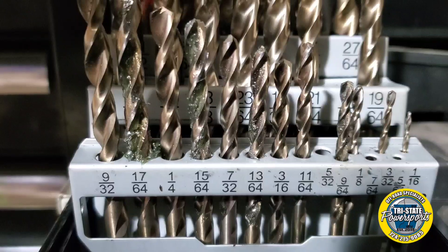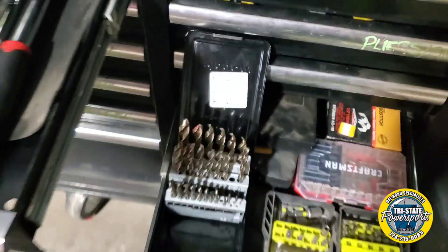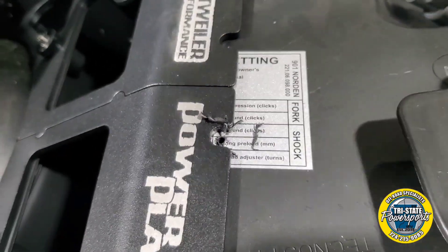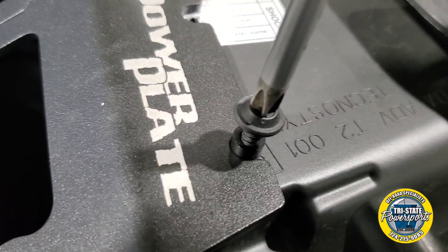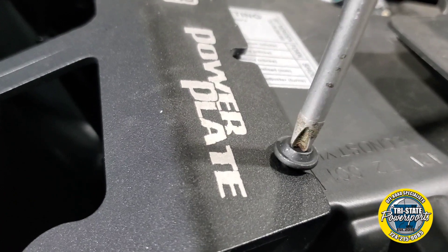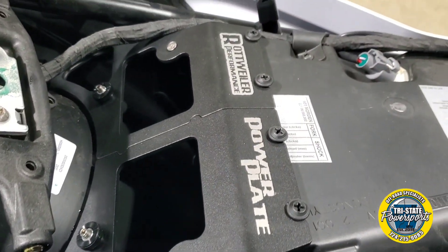If you are going to do it this way you are going to need a smaller drill bit than the screw — find something small just to make the hole in the beginning. I am using a 7/64th. You can use either the 1/8, 7/64th, 3/32nd, or 5/64th — anything just to start the hole. So all four of the holes are marked; now using our alignment marking with the self-tapper and the spacer, the holes are drilled. Set the self-tapper and the spacer back in — it goes in like butter. Do not over tighten. We now have all four self-tappers in with the spacers, tightened but not over-tightened. You can definitely strip out the plastic.